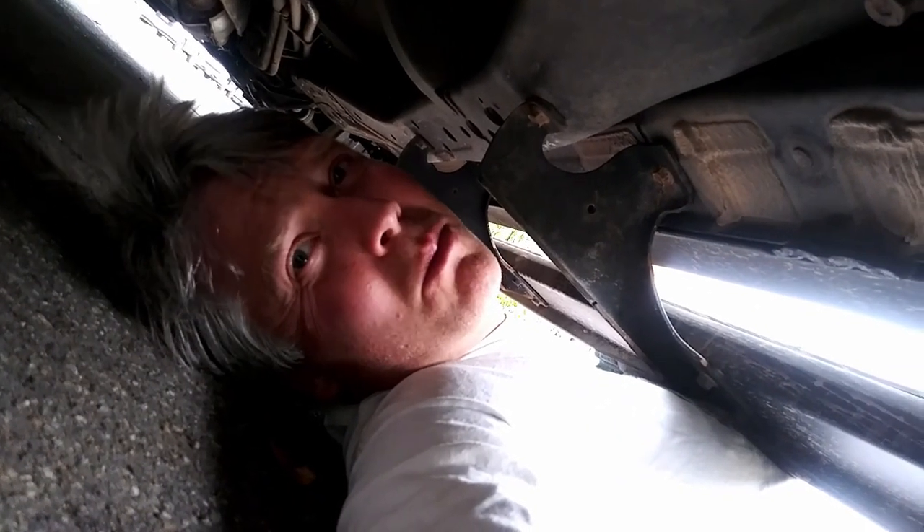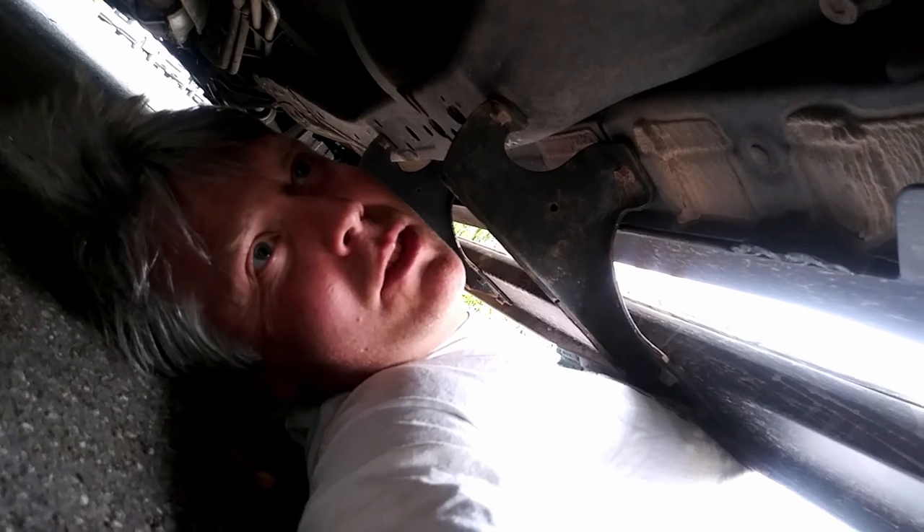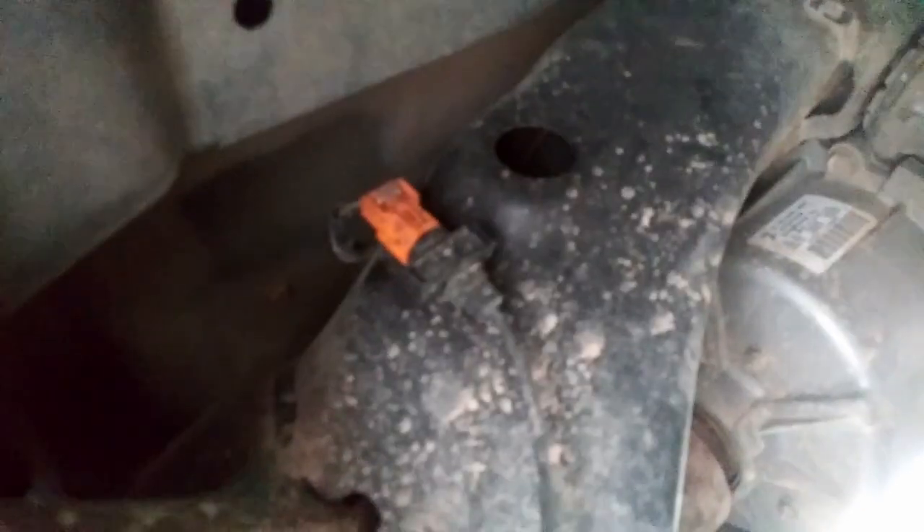So not even the sensor itself that's in the wheel, but the cable itself. Folks online were saying you don't really want to patch it because water can get in there and rust the cable, and that's not going to work. So I ordered a whole speed sensor to replace the whole thing from the wheel all the way to the orange connector up there. I'm going to pull that clip out, undo these bolts that hold the cabling to the knuckle, and then replace the whole sensor — hopefully that works.